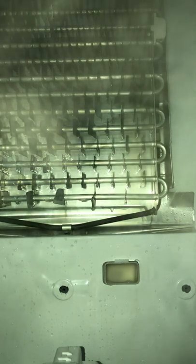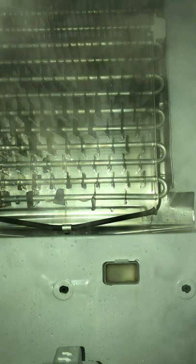Your drain is no longer able to release the water, so now your drain pan has water. Your heater comes on and turns that water into steam. What happens to warm air? It rises — it goes to the top.